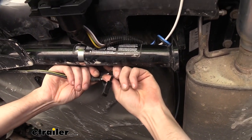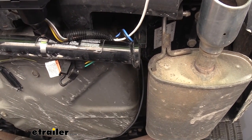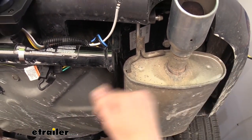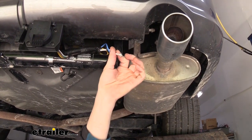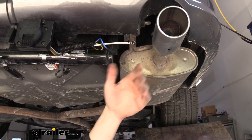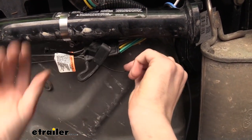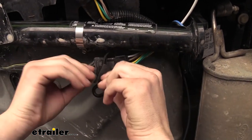The last connection at the back is our ground. Unfortunately on the Flex there's really no good ground location back here because we don't want to drill a hole into the trunk pan — that would allow exhaust gases and moisture to enter inside the vehicle. We want a solid ground attached to something like our frame rail. Our white wire is not long enough to reach those locations so we'll have to extend it. We'll hold off on that until close to the last step since we have a large duplex wire to run. 4-pole connectors commonly vibrate loose, so I recommend putting a zip tie around there to ensure that doesn't occur.